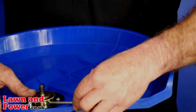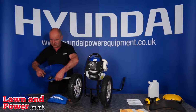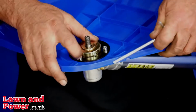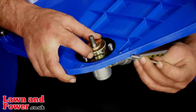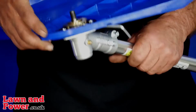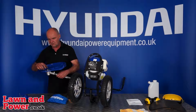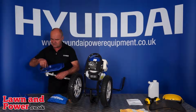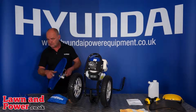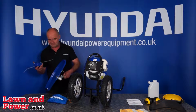And the way we lock the shaft off is by placing an Allen key in the slot, and that locks the whole thing off so it can't rotate. So it's quite simple. If you've got it in the wrong orientation, just rotate it around. You can do it up through this hole here when it's in use, and that's it locked. It goes up through the hole, you can see in the front, into the hole. You might have to rotate it to get the hole to line up, and locks it in place. Once that's locked in place, it can now not rotate. Then we get to the stage where we can screw the strimmer head on.